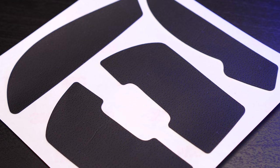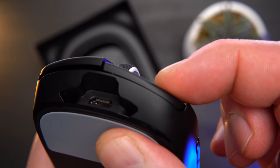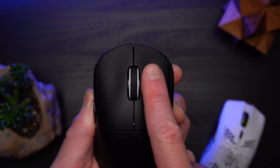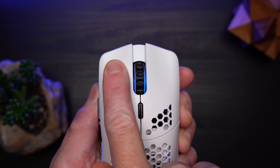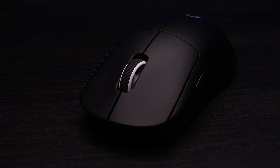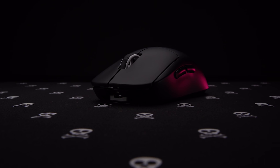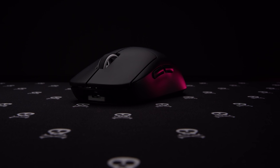Also included are thin rubberized mouse grips for the sides and the triggers both. The triggers feel exactly like the GPW to me — little to no pre-travel and obvious post-travel. They do suffer pretty pronounced side play as well. Nothing game-breaking, but they're better than the Viper Ultimate and not nearly as good as the MOW in this regard. Importantly, these have the updated switches we saw on the Shroud version of the G Pro Wireless, so that dreaded double-clicking should be mitigated to a much better degree. Logitech doesn't specifically say these are 20 mil versus the former 50 mil Omrons, but the actuator is that same gray-white color now instead of blue.